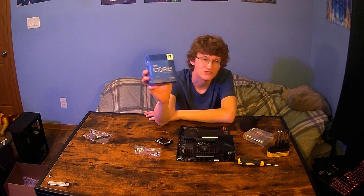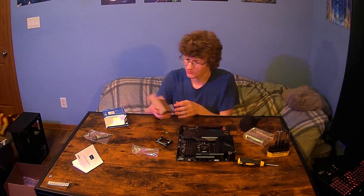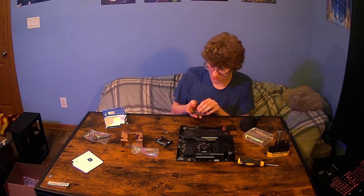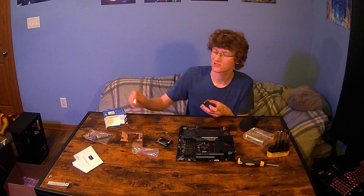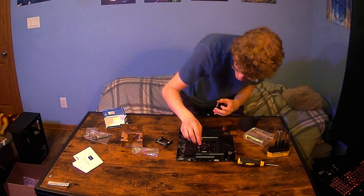The CPU I've picked out is going to help me a lot with my editing. It's the Intel i7-13700KF, and basically what that means is we're going to need an external graphics card, which I pulled out of my old computer. So I'm going to be very careful here to not bend any pins. My old PC had an 8th gen i7, which basically meant it had 6 cores, whereas this one has 16. Needless to say, it's going to be a pretty big improvement over what I had.